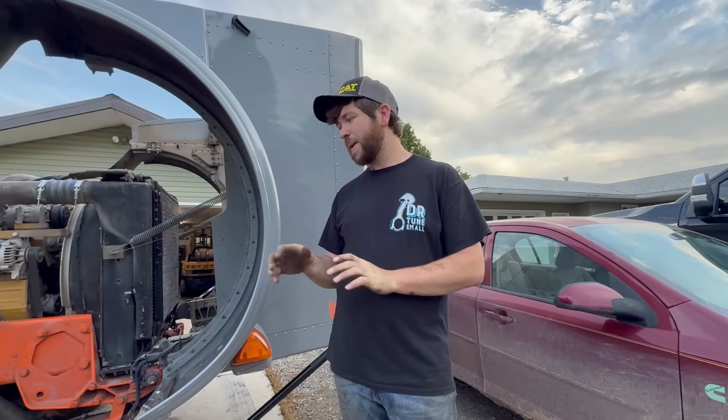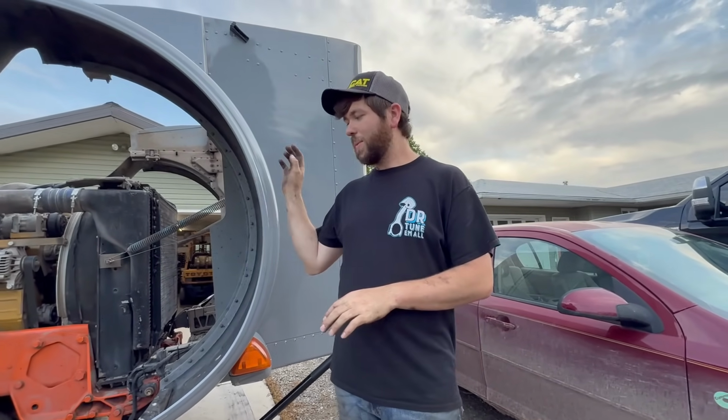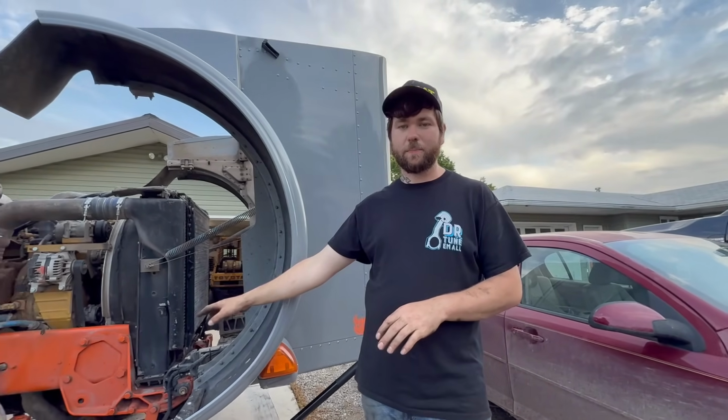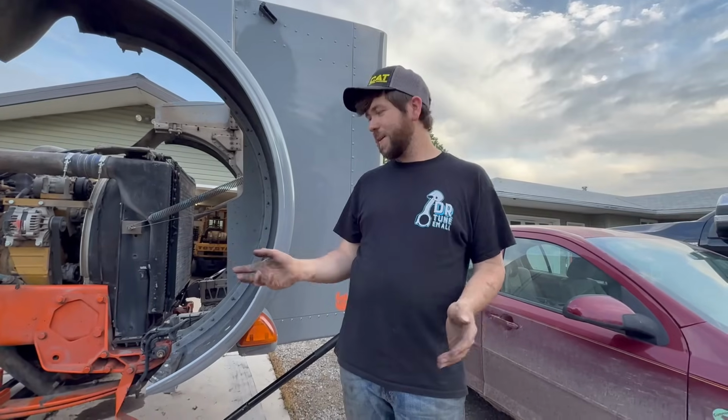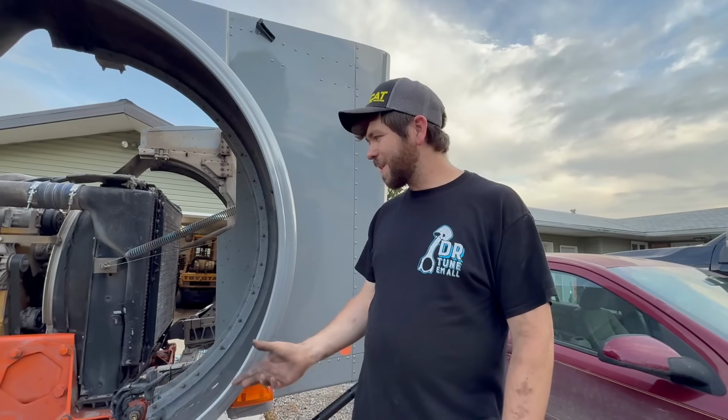But otherwise, we took them completely out. Like you said, I don't know, I can't remember what the shim was that was on the axle that was on the truck. But the one that came with the axle was I think a 3 degree. It said 030, so I went 3 degrees. That's the shim we put in. So hopefully that works. But otherwise, everything's going together pretty good.